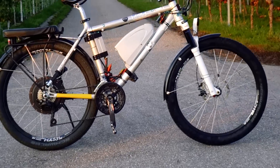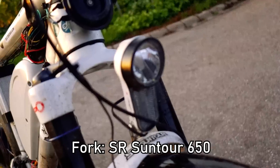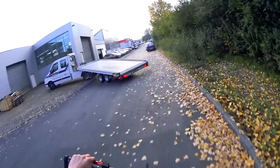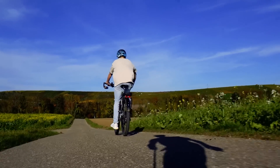But what use does great performance and an easily removable battery have when your e-bike is heavy? That's why I use this very light aluminum frame called the Musing Comp 7, and most of the components on this bike are also aluminum. If you want to build your own e-bike, I recommend you buy a decent mountain bike as the base — use a hardtail and not full suspension because you usually want to place the battery in the triangle. For the front I use the SR Suntour front suspension, though you'd even be fine without any suspension at all and could save some weight.